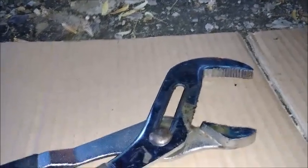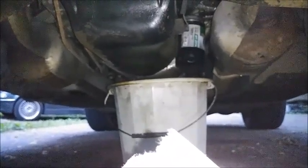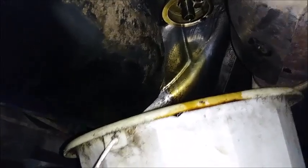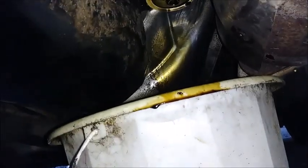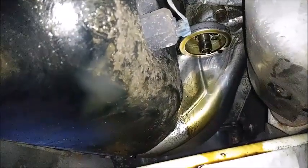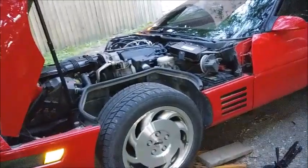If you were wondering how tight you need to get it — just hand tight — and you will still need a tool to get it off, even with the engine being as warm and toasty as it is. Now that we got just a little bit of a drip going, I should be able to fit in there, unscrew that with the channel locks, and then we'll be good to go. Anybody who's watched my channel long enough knows that I like to let my oil changes take at least 12 hours, ideally 24 or more. This one's going to take somewhere between 12 and 24, because unless I plan on washing and waxing this car tomorrow as it sits, I will probably just go ahead and add the oil after I button it all up tomorrow, put everything in, and then back it up.